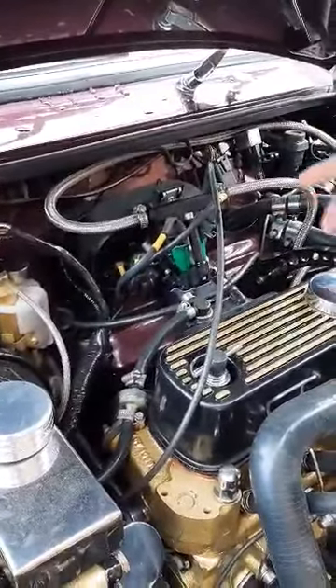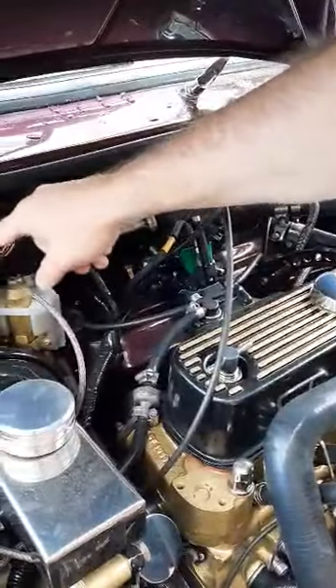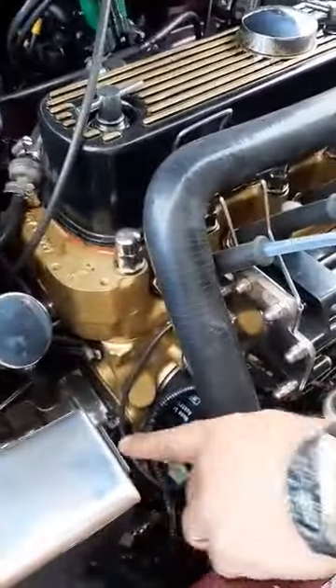On this car we supply an entire engine harness which picks up from the multifunction relay pack or ACU. There's the chassis connector here and here, which has the lambda sensor in it. The crank sensor is down in the flywheel housing.